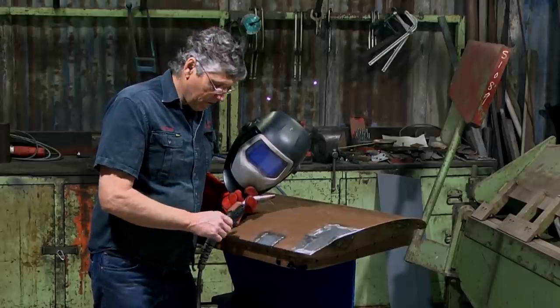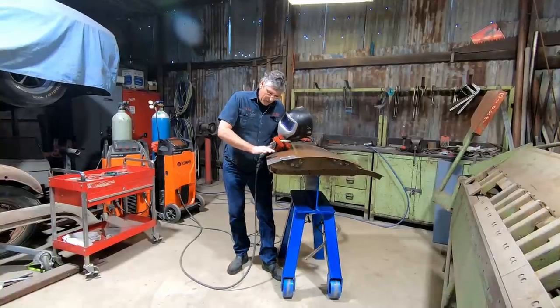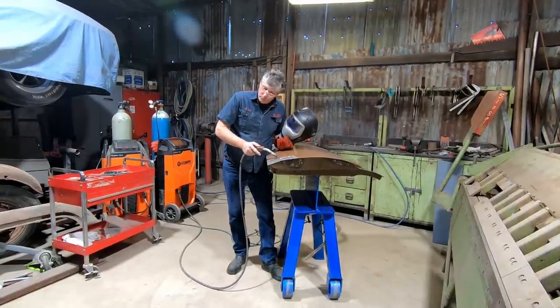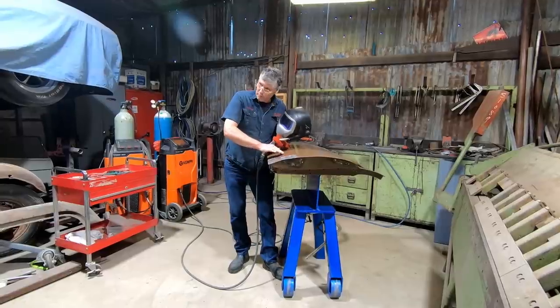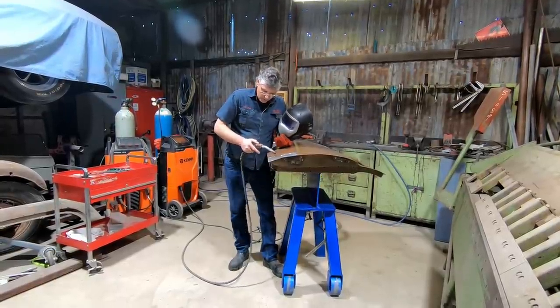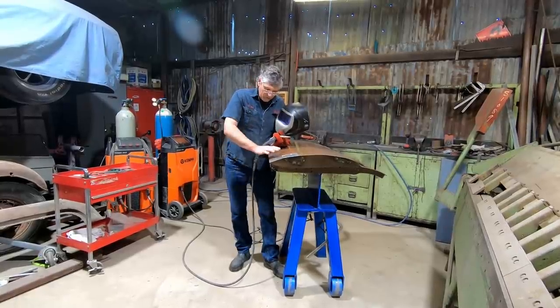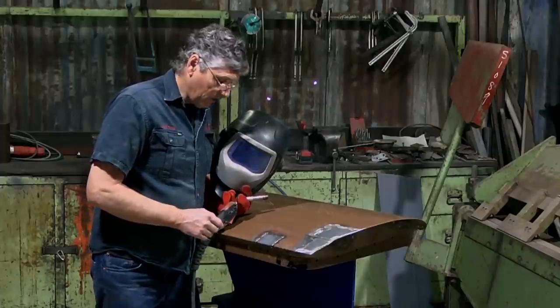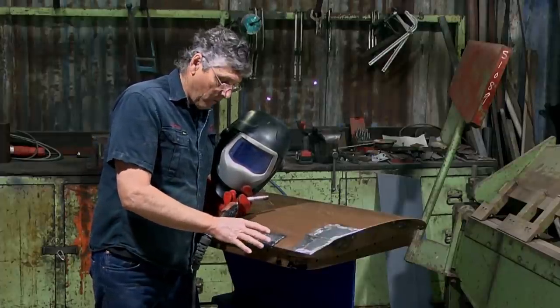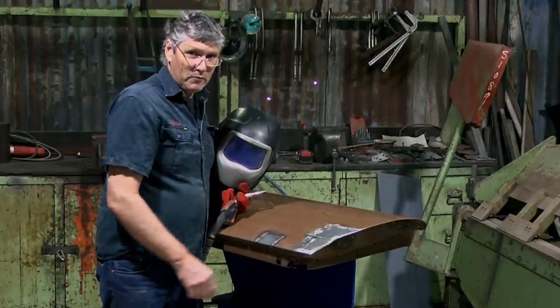Where we left it, we've got this area in here that had pulled up and it's raised this area. It's taken some of this little reverse curve out and we've got a little bit of a depression forming above this line in the door, and we've got low spots on each end of it. We'll let that cool down and then we'll work this a little bit, talk about some of the things you can do to get yourself out of a problem like this, and then we'll get into ripping this skin off and some decent frame repairs.